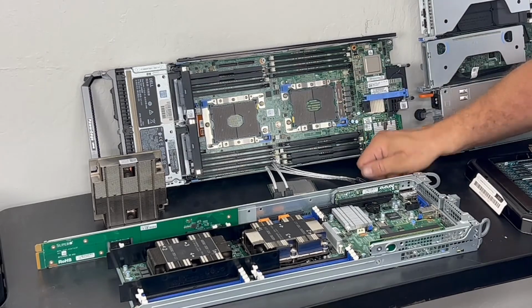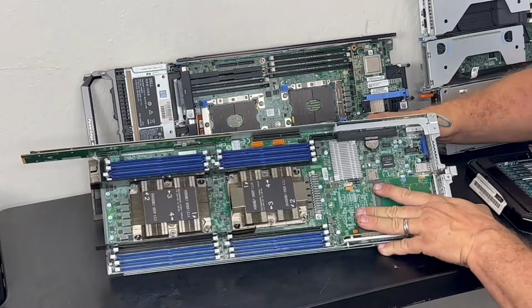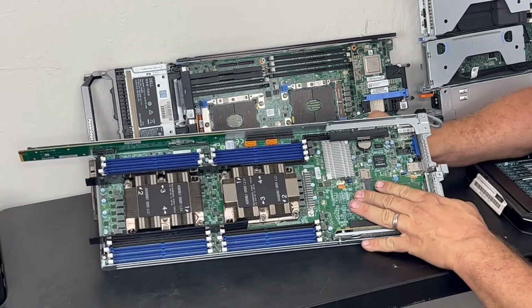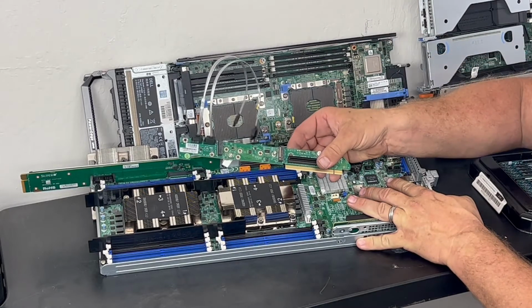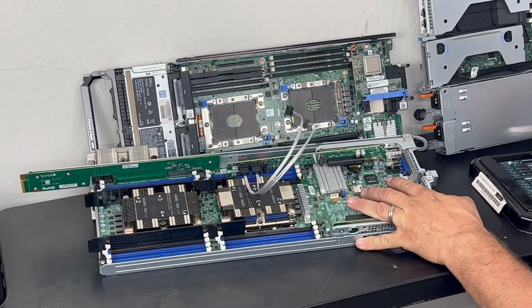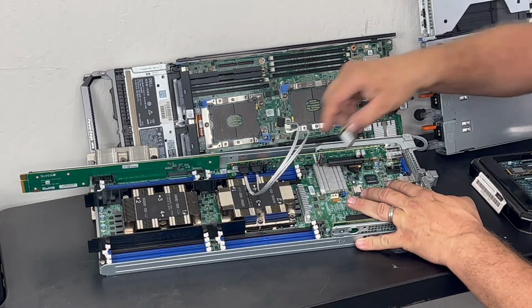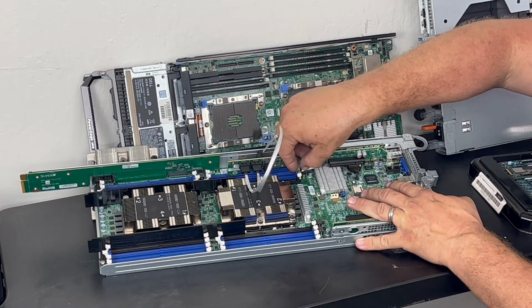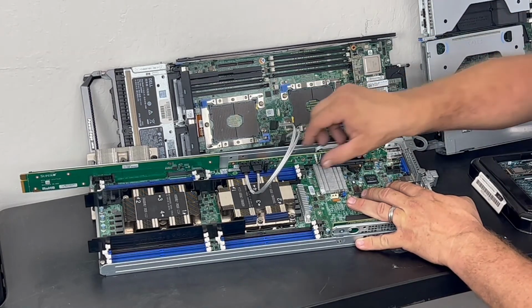And this is another indicative thing of how Supermicro does it, which is a little bit different. Supermicro does it in a little bit more modular system, so you can have your different components installed. You're going to have your risers right here determine whether or not you have your M.2 options. So you'd be able to fit an M.2 80, or remember that tiny little card? Well, you can fit it in backwards right here, and you can have redundant boot. Thank you, Innodisk.